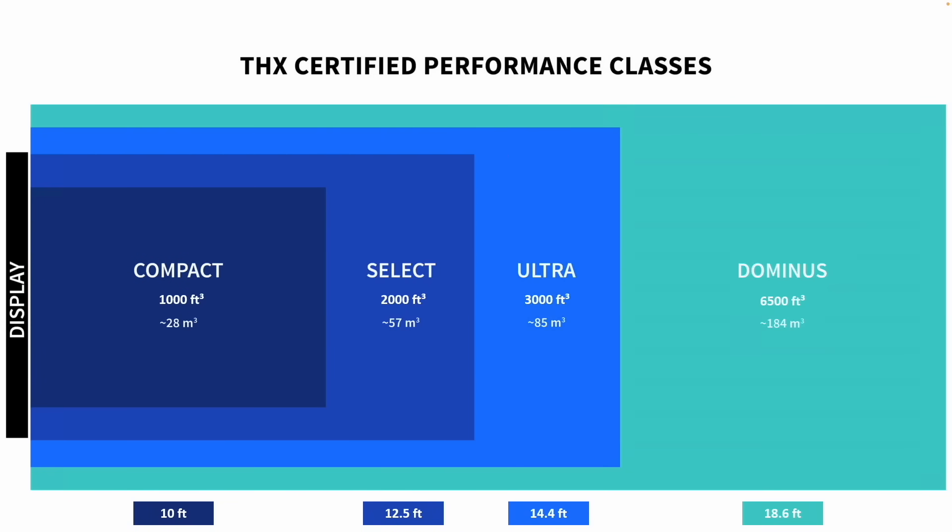They walk all over a lot of speakers in terms of tonal balance, but they do have issues with pure output. If you're planning on using these in a large room you'll probably want a subwoofer, and same for home theater use. In a small to medium-sized room you're going to be okay. Bass gets down to about 50 Hz in-room, which for most situations is fine, though ideally I'd prefer a speaker to reach 40 Hz. This one doesn't quite get there, so you'll probably want a subwoofer to fill in those bottom octaves.